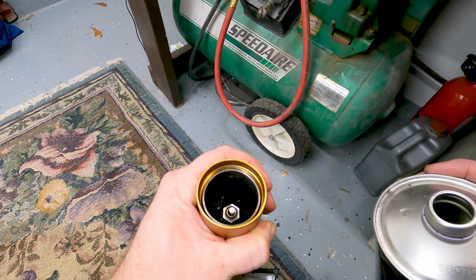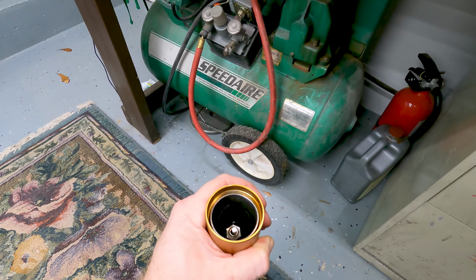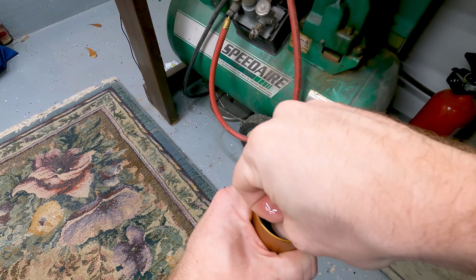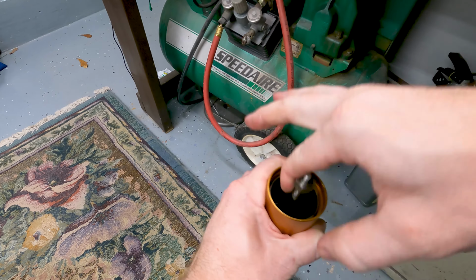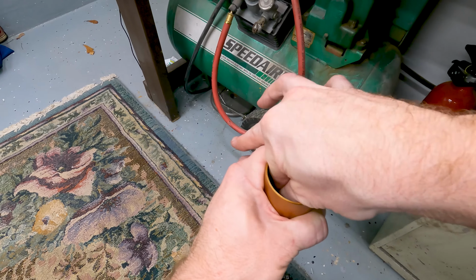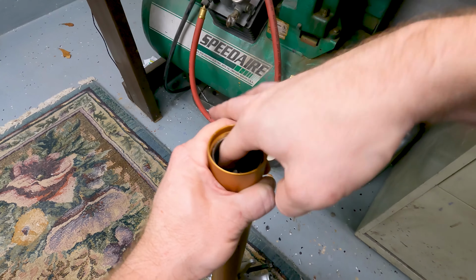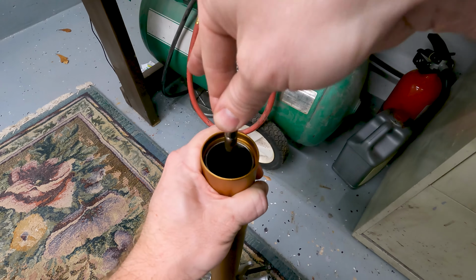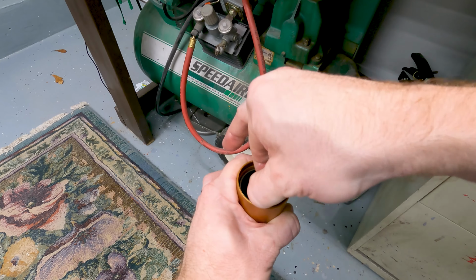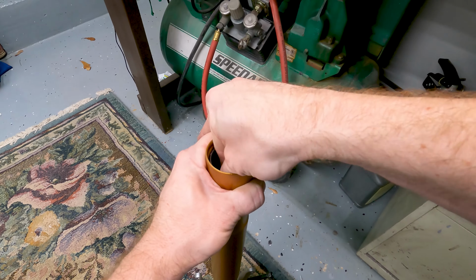So I'm gonna let that bubble for a minute. Okay. And then I'm gonna grab this rod, which is the dampening rod, and I'm gonna work it up and down, which is releasing the air out of the system. You can feel it when it starts grabbing. It helps to have the compression, I think it's actually rebound, whichever one's at the bottom out there turned all the way out.